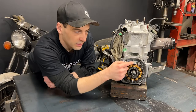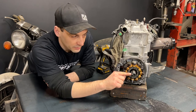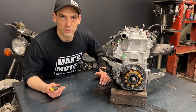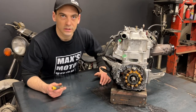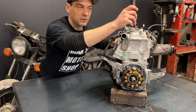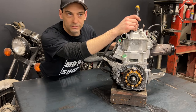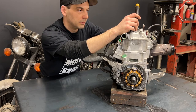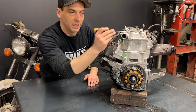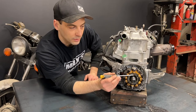To make it easier for you to see, I've gone ahead and took a white paint pen and marked the 12 o'clock position, I've marked my flywheel key position, and I've marked the 6 o'clock position. You can check the timing of your motor while it's in the machine. You'll need to take off your injectors and then take a clean screwdriver and put it down the injector hole. Then rotate the motor over until the piston is at top dead center. Right there is about top dead center on the mag side and as you can see, the flywheel key lines up with the 12 o'clock position.